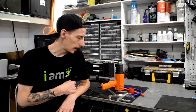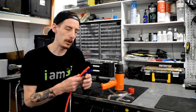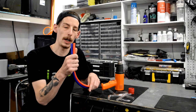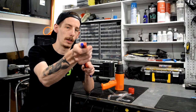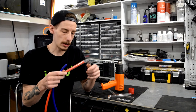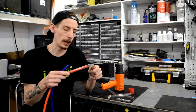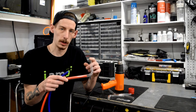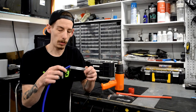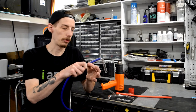Before it gets loud from turning on the heat gun, I want to go over some tips and tricks about heating up tubing specifically. So first off, you've got your inserts here. These two are both stated to be used for 12mm ID tubing, however they are two clearly different sizes. I find both work quite well — this one is still slightly loose, which is what I really look for in a good insert: the ability to put it in without any lube or water. You do sometimes need to use lube or water if you've got several bends to do, but even these very loose inserts still work well. You're only trying to keep the tubing from collapsing on itself.